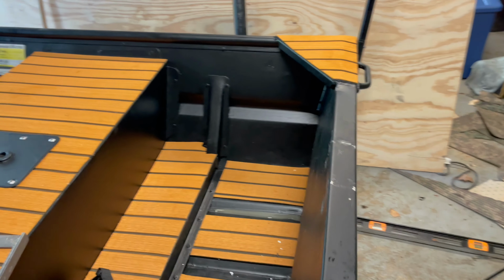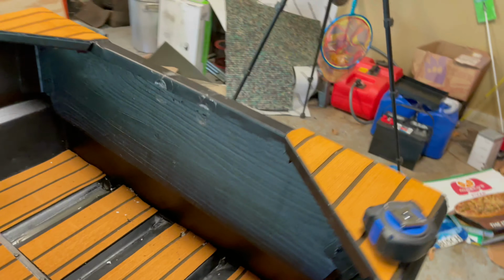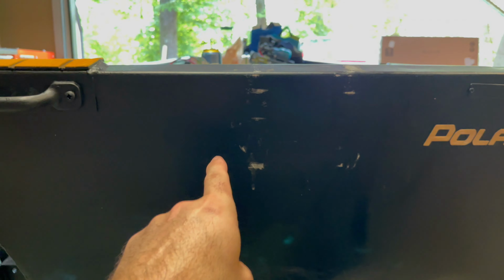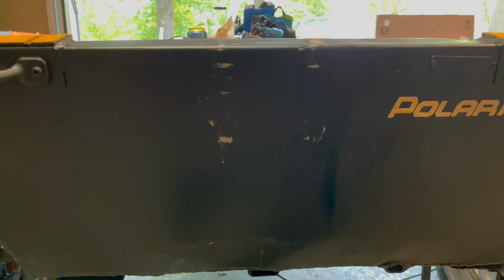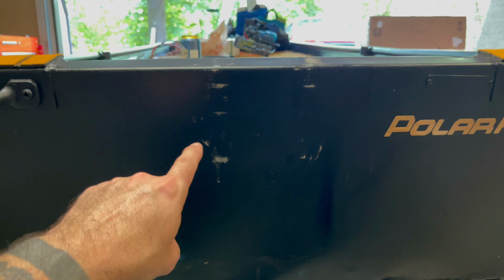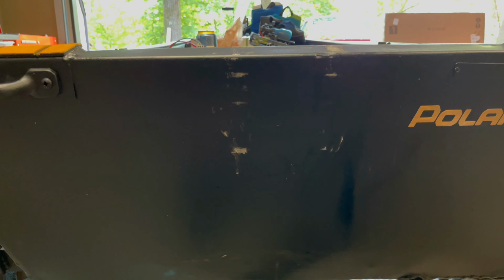But another thing that I'd like to do is this transom only has two bolts on each side. And then of course the handles are two more bolts, but they're up towards the top. So what I want to go ahead and do is add two bolts right here, just 5/16 bolts all the way through with fender washers. I mean, we're not going to be flexing this transom off of that powerful 3-horsepower motor, but who knows, one day somebody might add something to it, like a 6.5-horsepower Hankai 4-stroke. But let's go ahead and do that. We'll put some silicone in the holes and then put it on, like I said, with fender washers, all stainless steel hardware, and try to draw that transom up and make everything a little bit more solid.